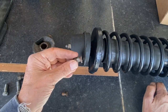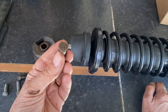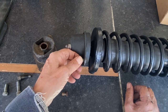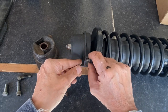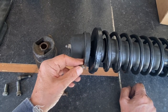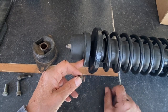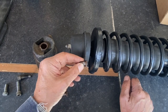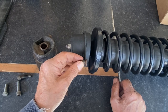In the last video I asked if anybody knew why there were these half-bolt screws that were used to hold these top mounts in on the struts. I couldn't see any obvious reason for it — there seems to be an awful lot of clearance here. The consensus of opinion from the comments is that on earlier Elans, maybe baby Elans, this mount is much closer to the top of the spring retainer cap, and that's why they had reduced heads. I'm not 100% convinced, but that may be the case.